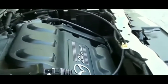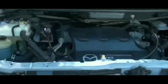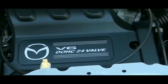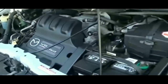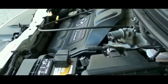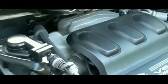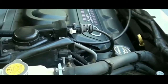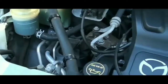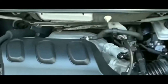Next, I took a 12-gauge wire, hooked it up to the battery, and tried putting it onto the small terminal on the solenoid to see if it would crank — nothing. At that point I knew the starter was malfunctioning. Spent a couple hours taking it out. It was still under warranty, so I took it to AutoZone and got it replaced. I had the choice of a brand new starter but didn't want to spend $300, so I got another rebuilt one — and it runs fine now.